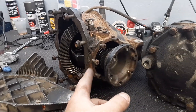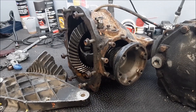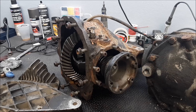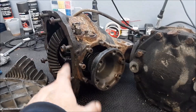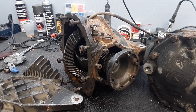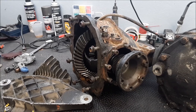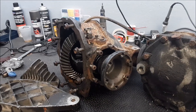This is the original differential out of that car. It's an ASR car, which did not help. I think it's going to be a lot easier if you have a just-ABS car, a non-ASR car. The gear that I wanted only came in one specific car and it did have to be the larger case — this is the small case. I needed a larger case differential, which came in the V8 cars, but it also came in the R129 300SL. That particular early 300SL came with, in my opinion, the best rear gear for performance anyway, and that's the 3.69 rear gear. So that was what I was stuck with making work.